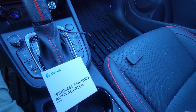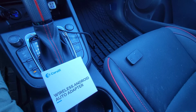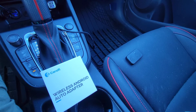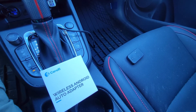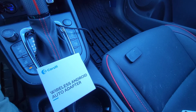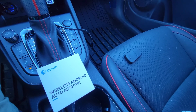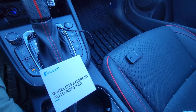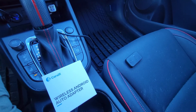The first connection can take a couple of minutes as the dongle and your phone discover and adapt to your specific entertainment system. Once everything is connected, test it with some media and a few Google Assistant commands. Then I recommend doing a cold start of your vehicle just to see how long it's actually going to take to connect. Turn your car off for a few minutes — for example, my Kona continues to power the USB port for five minutes after shutting the vehicle down. Then start it up again and you'll see the connection only takes about 15 to 20 seconds.